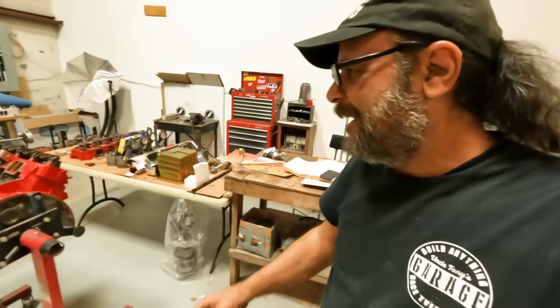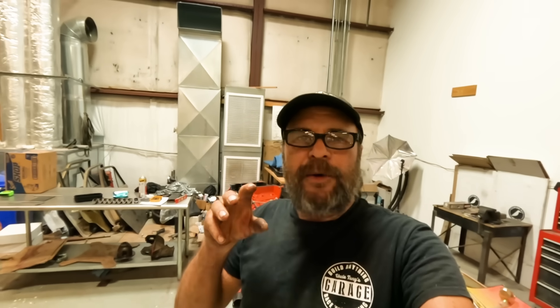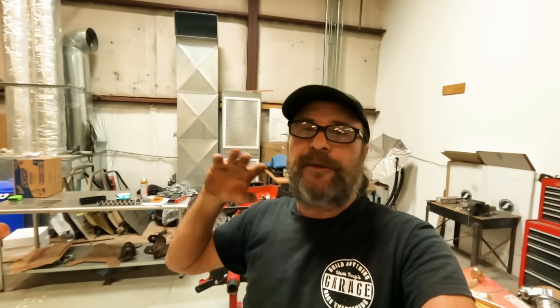And it's the very thing that sets the Chevys apart from the Chryslers. It's in the rocker arms. It's in the design of the valve train. Chevy engines, whether they're hydraulic or solid lifter - and I'm talking about the traditional ones, the small block Chevy - all of them have a ball stud rocker arrangement, meaning they're all individually adjustable. So when you set one of these engines up for high performance, you set the thing for zero lash - this is assuming a hydraulic cam - zero preload, and now you take full advantage of whatever breathing capabilities that engine has. So they'll pull to 6,500, 7,000 RPM clean. They work really good.